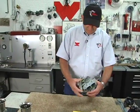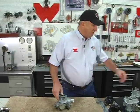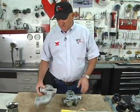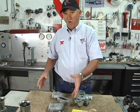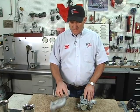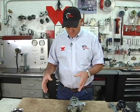Now the carburetor itself is pretty simple. It's a standard 4-bolt footprint. Goes on. In most cases, these carburetors are used in a plenum environment, which means one carburetor feeds the whole engine. 2-cylinder, 4-cylinder, 6-cylinder, 8 cylinders. It feeds out of a plenum. So the purpose of the carburetor, which only has one job, is to put a balanced air-fuel ratio to the engine from an idle to 10,000 RPMs. Wherever you're going, you need to get a balanced fuel ratio for it to work well.